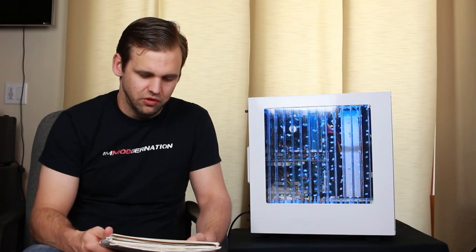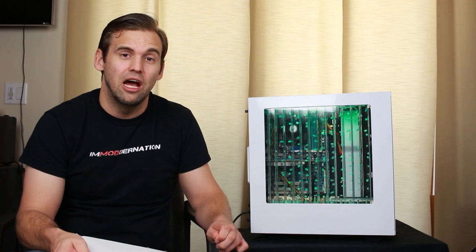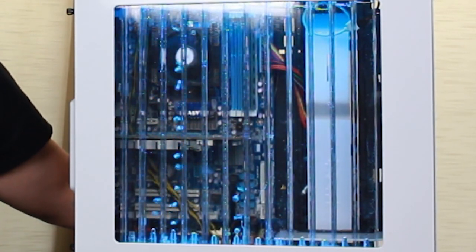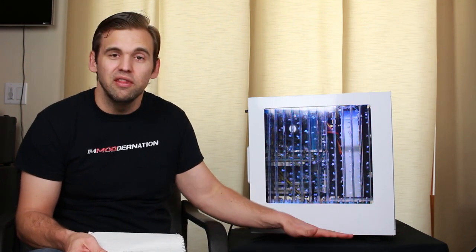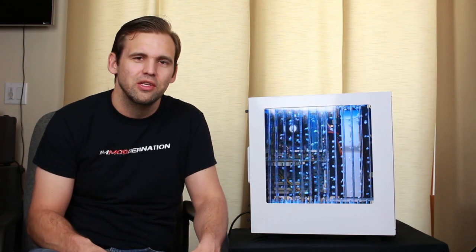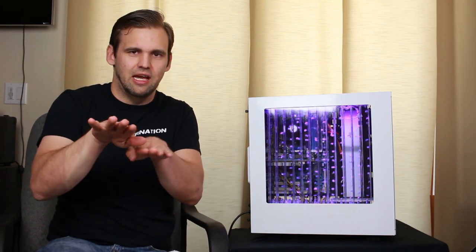Let's talk about what I do in this video. So, actually, I have everything written down here. In part 6 and 7, I'm going to be installing the fan controller. The fan controller in the back is going to allow me to adjust the speed. It could also allow me to turn off and turn on individual pumps. I'm going to be mounting the pumps to a platform and then putting them inside of the case. You'll begin to see how tight and compact the NZXT S340 case is. There's not a whole lot of room, so I had to mount the pumps in a specific orientation. It's kind of like this step by step diagonal. Can we make a GIF out of that?